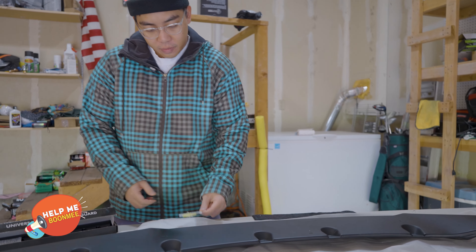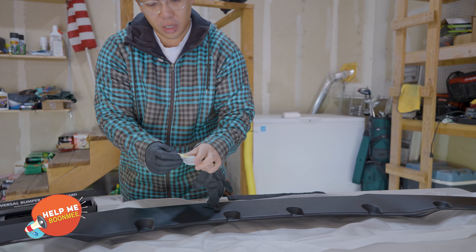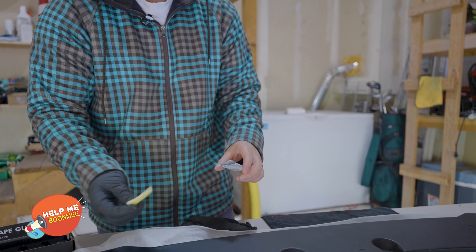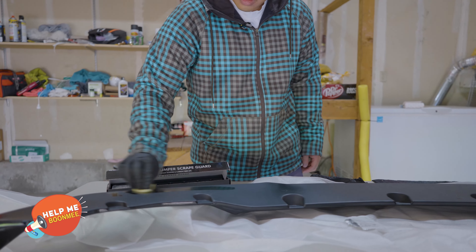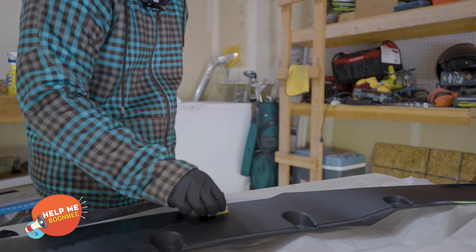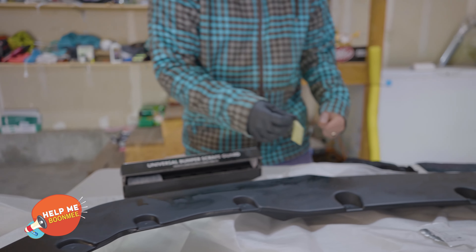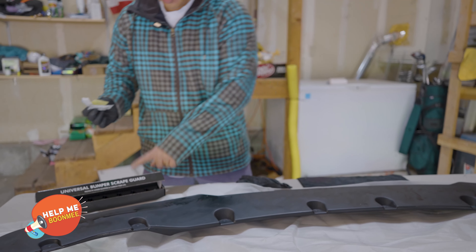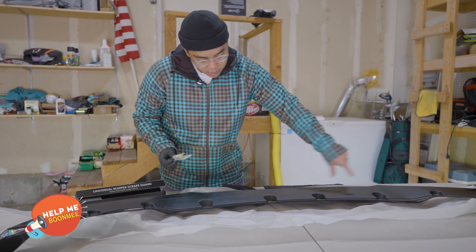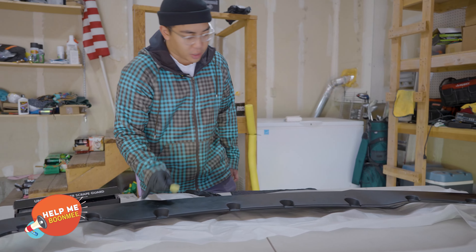This is basically automotive adhesive primer — let me put some gloves on. This will make sure that the 3M tape on the back of the Slip Low pieces sticks to the lip. I'm just going to wipe this everywhere I think it's going to be. It comes with two so you should have plenty. You want to let it get all over and then let it dry — don't apply the Slip Low while it's still wet. I would use a majority of the Slip Low in the furthest reaching areas, kind of in the corner of the front lip, where I had the most scraping issues.